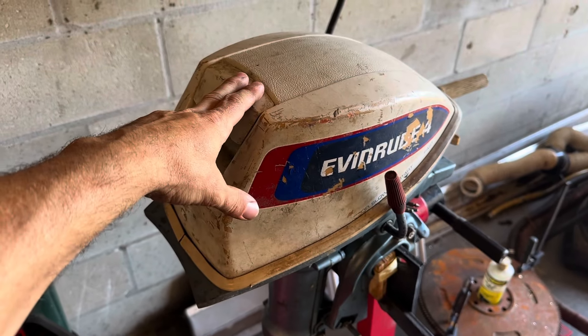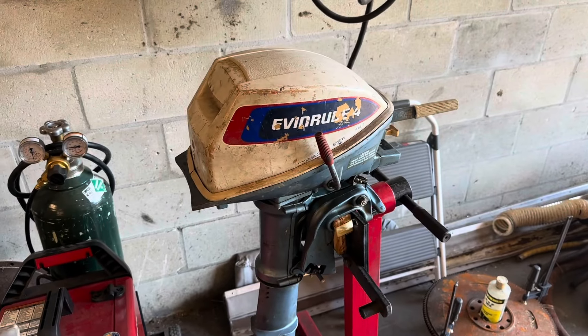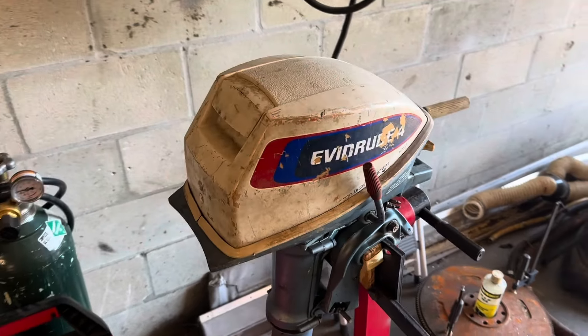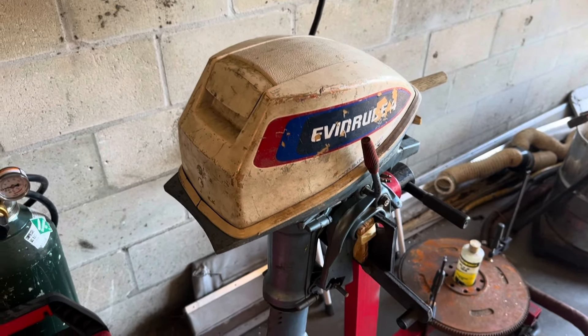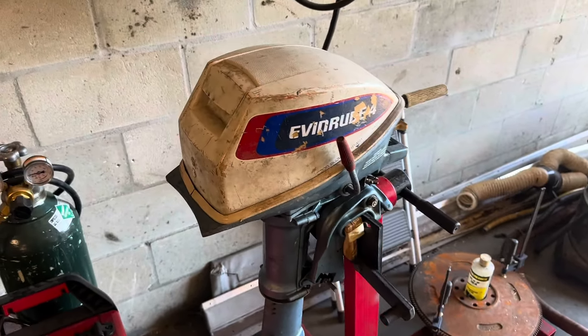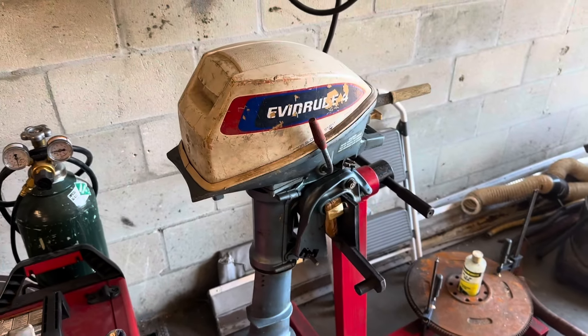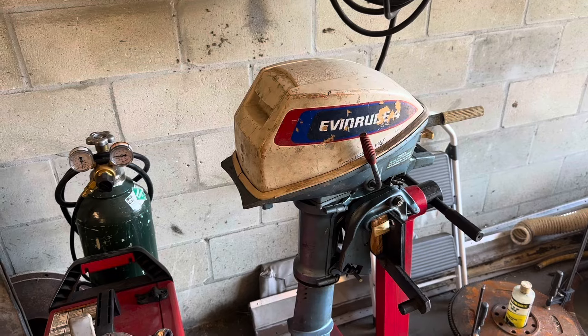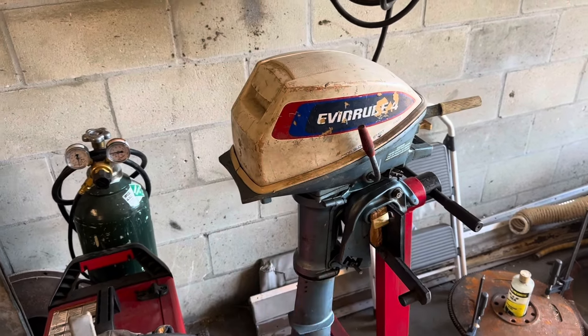I have a video that I took when I got her back from the river this past weekend when I was running it in fresh water, doing my clean out and then running the carb dry. You guys can hear that slight tick — it's actually the coil. I think it's arcing off somewhere onto the flywheel. Because you hear it do this weird click, click, click, click, and then it'll come back into it and then click, click. Let me just put in the video real quick.